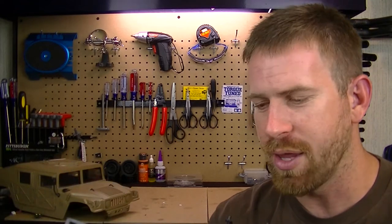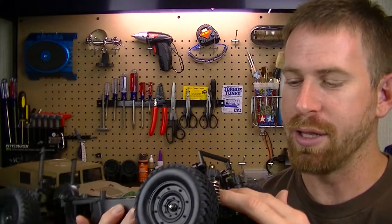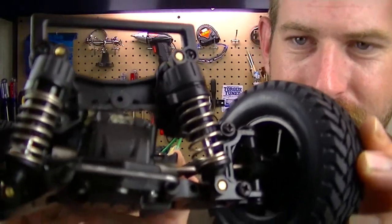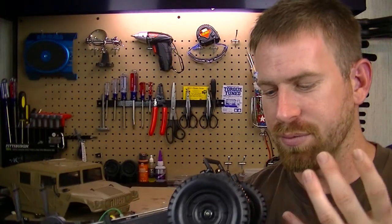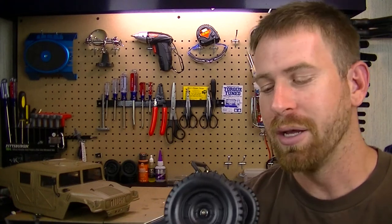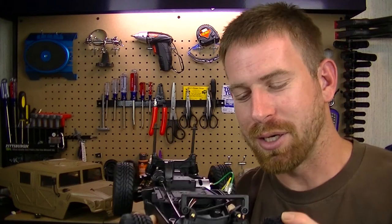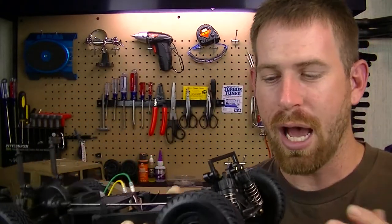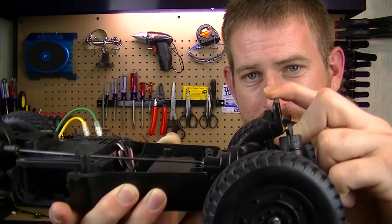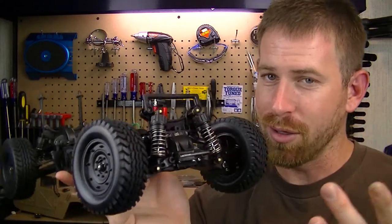When I went to test it out for the first time inside the house, it actually broke loose. The two screw holes just kind of broke apart — I think dry rot or something. I didn't really want to order another part and spend more money, so I tried the cheap method: gorilla glue. But that didn't fix it, because the way it mounts, it's supposed to pull the shock mount forward to raise the body up. The gorilla glue forced it backwards, which caused the binding issue.